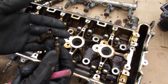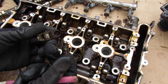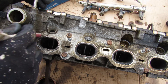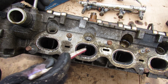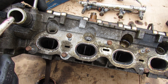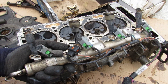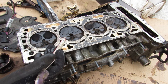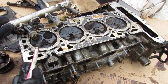You can really see how this engine makes a lot of use of oil pressure, and if you don't change your oil on time or don't maintain correct oil quality or quantity, bad things can happen. Taking a look at the intake side, we've got oval shaped intake ports. On the outside it's really crusty with carbon deposits but on the inside it's nice and clean with gasoline injected right there — that's the advantage of port injection, it keeps your valves nice and clean. We've also got the upper radiator hose coolant outlet here. The exhaust side has more of a square shaped exhaust outlet. Newer Ecotec engines put the fuel injectors right inside the combustion chamber for direct injection, which gives better fuel economy and more power, but you will get a lot of carbon buildup on the valves because gasoline isn't there to wash them off.